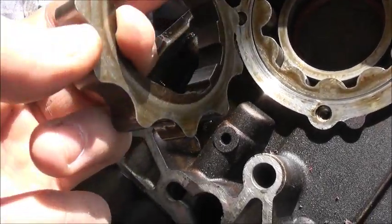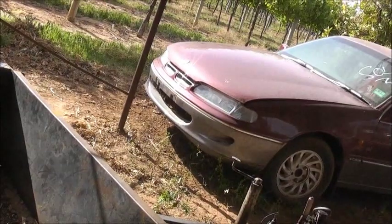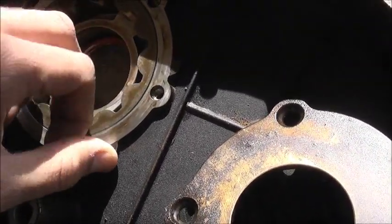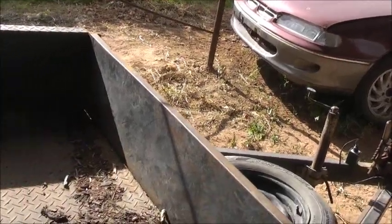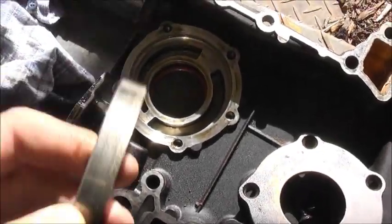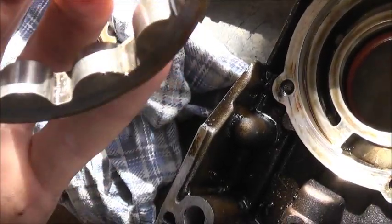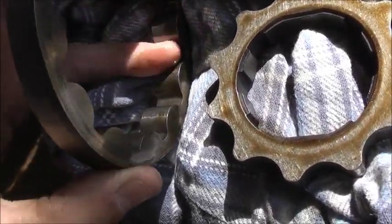You can see there's no metal filings in here. But if it gets bad, that'll have metal filings run through here - that's quite a bit of damage from a spun bearing. The amount of knock that engine had - I showed in a previous video the play it had, moving the crank back and forth. It had a fair bit of play; I reckon about 10mm of play. So all that metal floating around in there would have got caught in the filter, and fine bits would have got pushed through here and damaged the oil pump. There's not much pitting in there either.